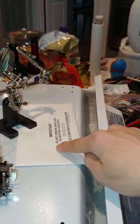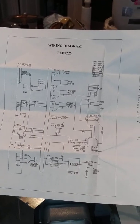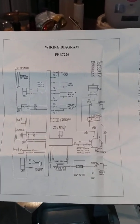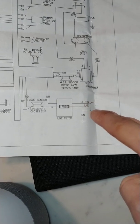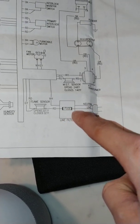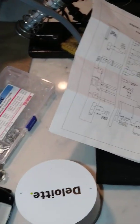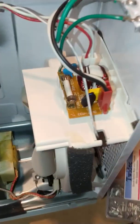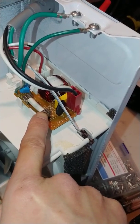When I first got into it, I noticed there was an envelope. GE was kind enough to provide the wiring diagram and basic information about the circuit. There's neutral, live, and ground coming into the line filter. I checked the fuse first for continuity, and that looked okay.